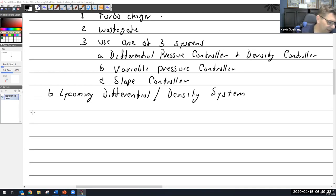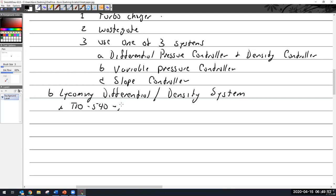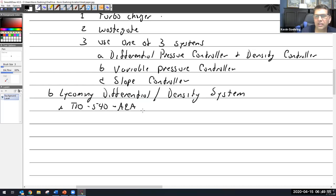This system is used on the TIO-540 — turbo injected opposed — alpha to alpha, which describes the accessory case and makeup of the engine. It's used on the Piper Navajo. It is sea-level boosted by 10 inches, meaning we should see about 40 inches of manifold pressure at full boost.